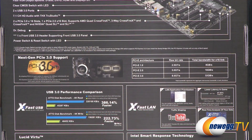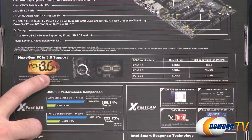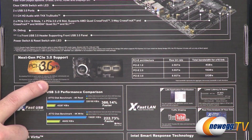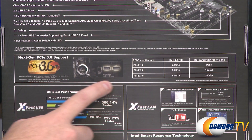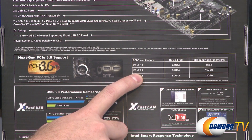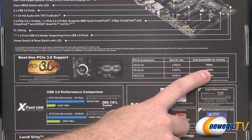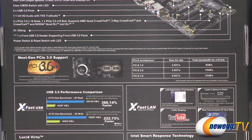The Gen 3 in this motherboard's model name stands for PCI Express 3.0, which is the new PCI Express standard that is coming out. It is not out yet but this board does support it. Your PCI Express controller is actually integrated into your CPU, so right now if you have a Sandy Bridge CPU you get a PCI Express 2.0 controller, which gives you 5.0 gigatransfers per second and 16 gigabytes per second effective bandwidth.